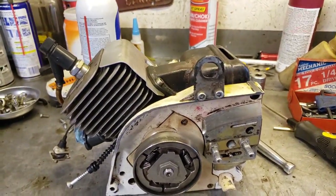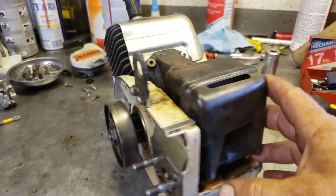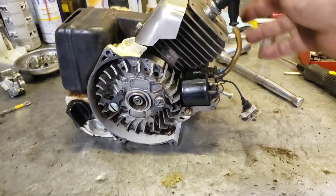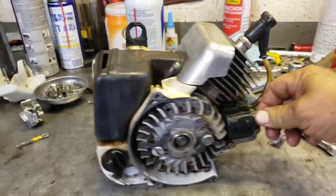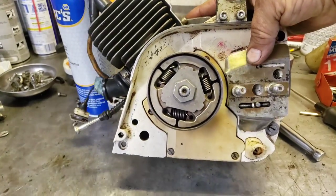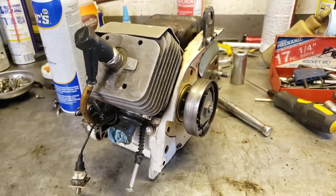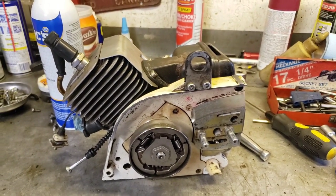We checked spark, that's good. Checked the cylinder, that looks good. Cleaned up the muffler, cleaned up the saw. This one's electronic ignition, so there's no points to worry about. Checked out the oiling system. That looks pretty good. So next thing, on the next video, we'll pop a kit into this carburetor. We'll put that back on, we'll put the saw back together, and then we'll see if she runs.